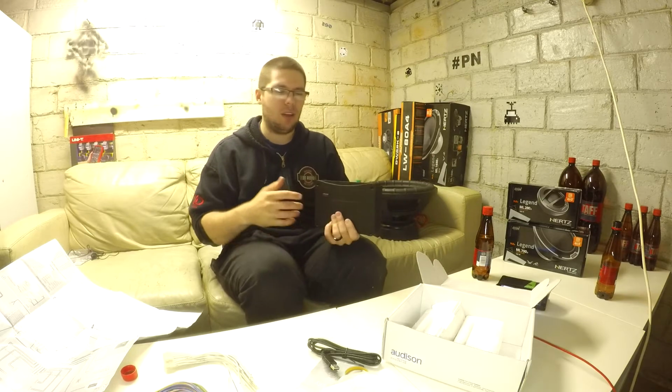and time align those speakers, those signal inputs, so you can match it on your amplifier. So if you want to install a nice amplifier in an OEM car, this is it, without having too much time to adjust and listen and try to figure out what is wrong in the system.